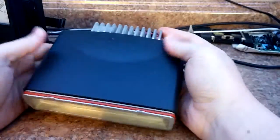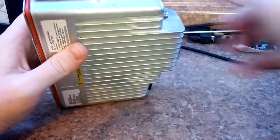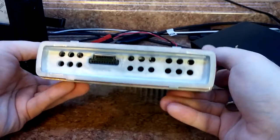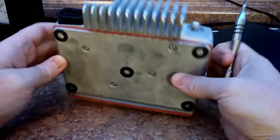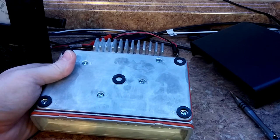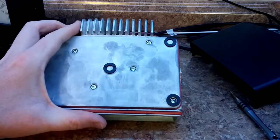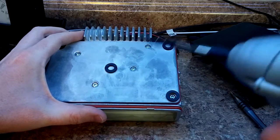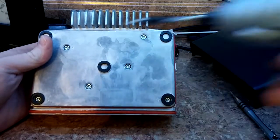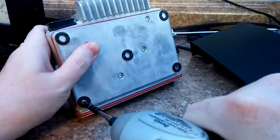That's the control head, and that's actually pretty easy to work on if you need to. You don't even need it attached for most of what you're going to do. Here's the brick of the radio. This plastic cover just pops right off. You can see everything is in this wonderful aluminum enclosure — well shielded. For me to build something like this, it's more time than it's worth. We're going to use the T20 tool to pull these screws out. You'll see they're numbered, and I like to go in reverse order when disassembling since the numbers are for assembly.